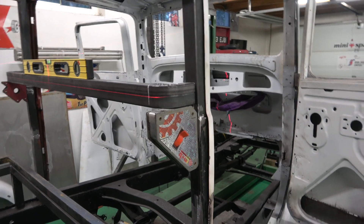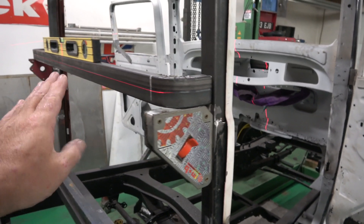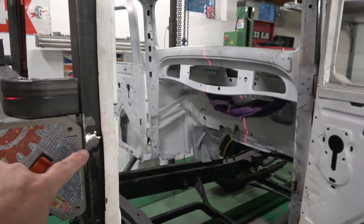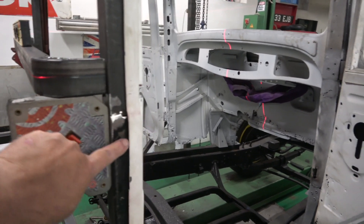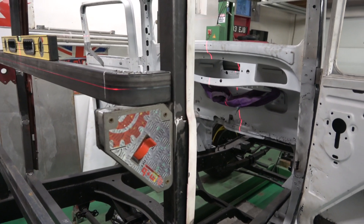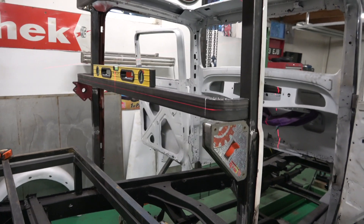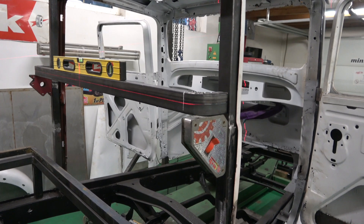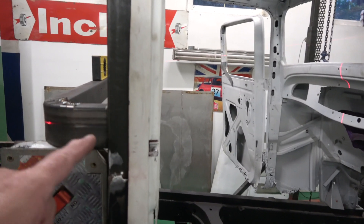The throat won't take it, so I'm going to have to do it in two halves, which will make it a lot easier to bead roll. I can use this bar as the lap-over point where we lead-load it afterwards. I can bead-roll this section to go into the concave bit, put a bead lower down, and then the window at the top. It does mean welding it all, but that's what it is.